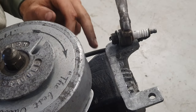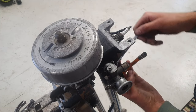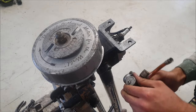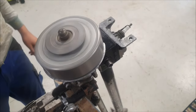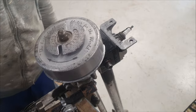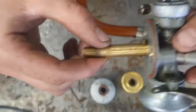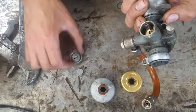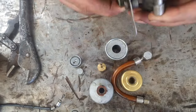I don't think the spark is actually coming in soon enough. She started there! All right, now I know the engine's gonna start and we have our spark back again. We're gonna have to sort out the fuel, so this carburetor probably needs a rebuild.